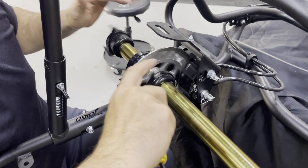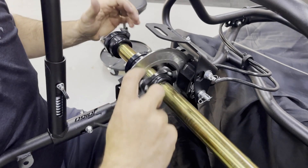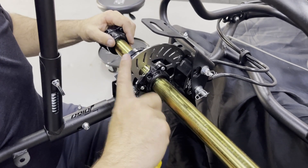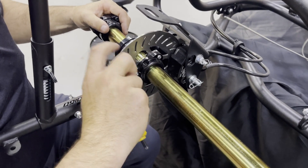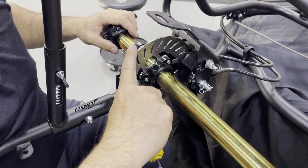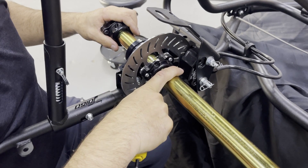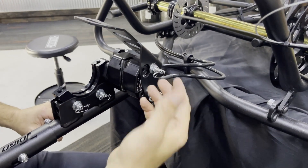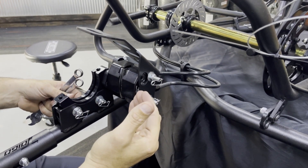Now it's tightened down, we have our safety wire on it, it spins freely, it doesn't nick or touch the brake pads, and the brake should function correctly. By the way, this is a 1/8-inch brake rotor — there are 3/16ths ones sold as well. You will need to adjust the brake pads and their location to use the 3/16ths on our car, but that's a later video.